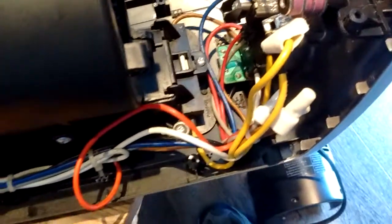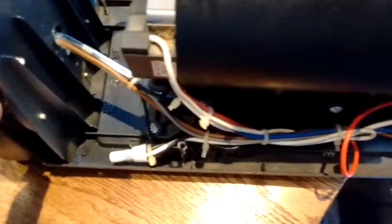I don't have an air compressor I can drag into my house — it's out in one of my sheds running on 220. I do see a spot right here that I'm going to come back in with a brush to clean up. I'm going to test it and see if cleaning got rid of my rattling problem. It definitely upped its efficiency by getting rid of all that grit and fuzz that was hanging out inside this blower and on the heating element.